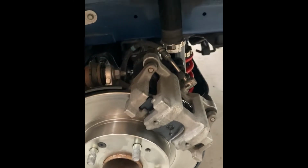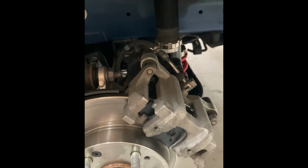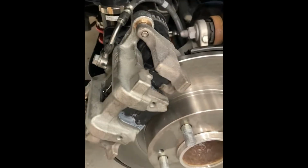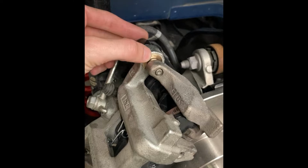It's good for keeping grease in. It's easy to install and it's very cheap, which is why you see designs like this. But for racing purposes or getting good brake performance and not having terrible pad taper like that, it's generally a poor design. So what we've come up with is these bronze bushings.